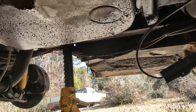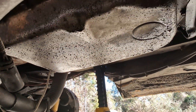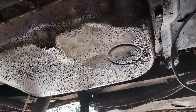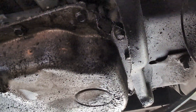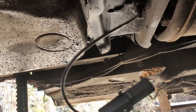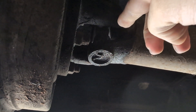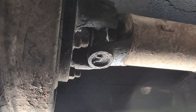First thing we've got to do is get the fluid out of it. Unfortunately I don't think there's a drain bolt on the pan, so we have to do this the hard way — you get a pan, start loosening the bolts, and let the pan open up at one side and waterfall the fluid into your catch pan. After that we're going to separate this driveshaft. This is a bolt-on type, not a slide yoke — it's bolted on right here like a pinion is. We'll unbolt that and knock her loose.